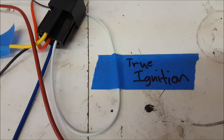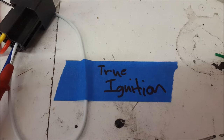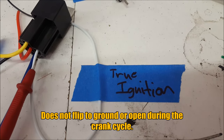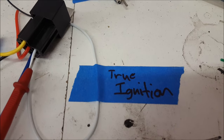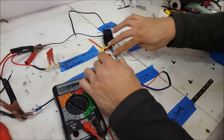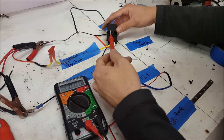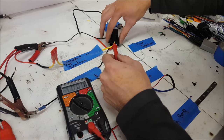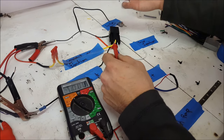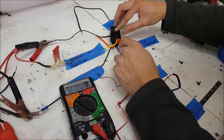When I talk about true ignition, what that means is during the crank cycle, it stays at 12 volts the entire time. If it goes to ground during the ignition cycle, that means you have accessory — and you can't have that for your fuel pump. You need the fuel pump to be pushing fuel the entire time during the crank cycle. Now, how do you make these two connect together? Essentially what a relay is, is just an electromagnetic switch. When you connect ground and 12 volts on pins 86 and 85, an electromagnet activates and it moves the switch over to connect 87 to 30.